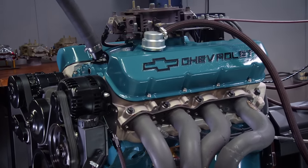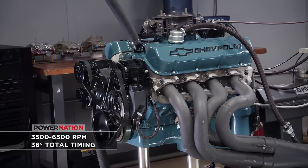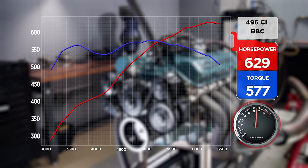The 496 cubic inch big block Chevy is on the dyno and running, topped with a 1050 Dominator dyno carburetor with no spacer for plenty of hood clearance. After preliminary pulls and tuning for pump gas at operating temperature of 175–180 degrees, we make a pull: smooth as glass. The result is 629 horsepower at 6,200 RPM and 577 pound-feet at 5,100 RPM — with a beautifully flat torque curve that just carries through the RPM range.